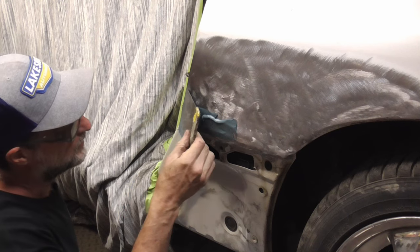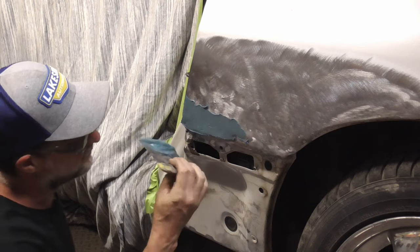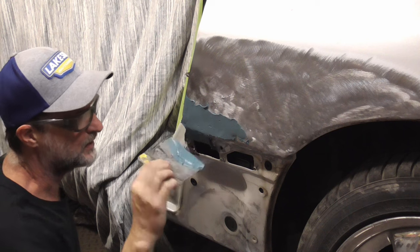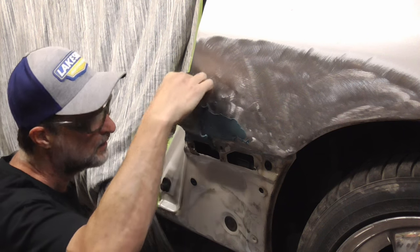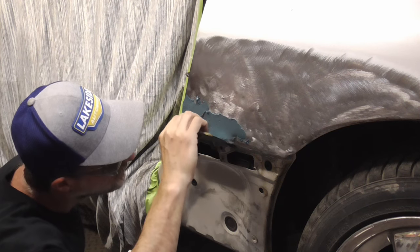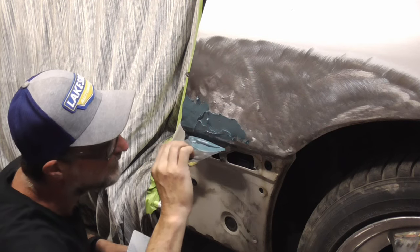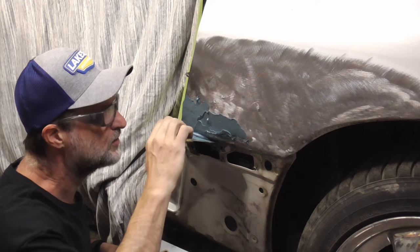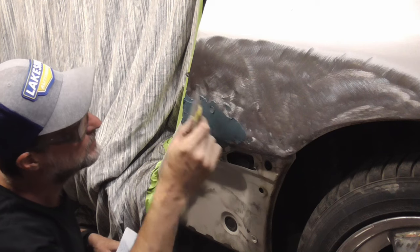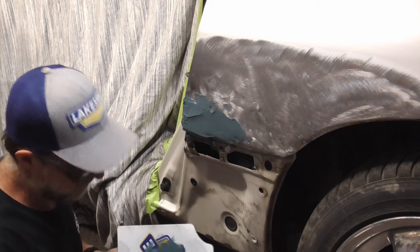And we'll be starting with the first coat. It will just be a layer of fiberglass reinforced filler because it needs to be a little bit thick right here. And we're just going to build it up right there with some fiberglass reinforced filler first, and then we'll hit it with the regular filler. So we're not going to worry about this right now, just this body line first.